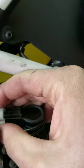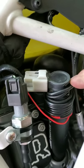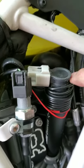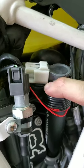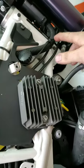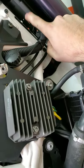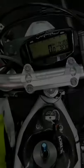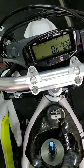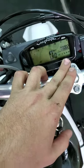Because the cable was too long and I didn't want to cut it — since I want to keep the ability to change readings — I wrapped the cable around the coil as if it were another kind of coil. Then I routed the cable behind that part of the bike, put a zip tie down here, and ran the cable up to the headlight area. Now, like the original gauge on the bike, you can use it without any power switched on without any trouble.